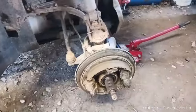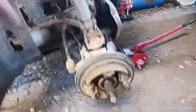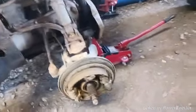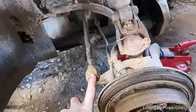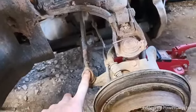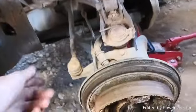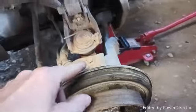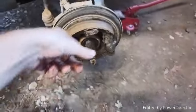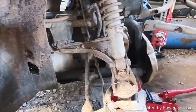Alright, so to take one of these front ends apart, you have, what is this, a 15/16 socket to take the big bolt right here off. That threads off, comes off like so. The castle nuts on this and this are both a 17. You'll need a socket, shallow well or deep well does not matter for these. You will need an open end wrench 17 as well for this one right here. And you tap them right here and right here on the knuckle to free these joints. Put that one out of the way, let that drop down, and this whole thing should just come right down. Pop the axle out, put the new one in, and there we go. Or let's just say I hope it goes that easy.